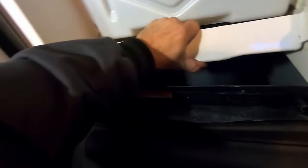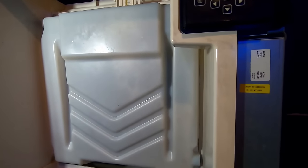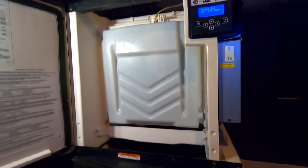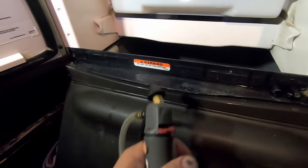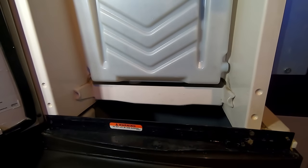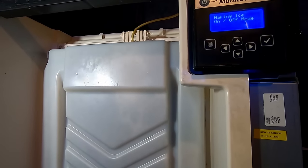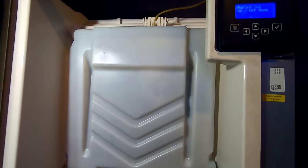Got that back into place — we'll start her over one more time. I've got the keypad on order, so we'll come back and run the cleaner through the actual machine — the disinfectant and sanitizing solution — when we return, since right now I can't get that button to work. The drain was plugged up, so I went ahead and hit it with my drain gun and blew it all out, then ran hot water through it — as the old plumbers say, hot water cleans out your pipes. That's as good as we can get for today. We're going to run one more batch of ice through here and see how long it takes to make. If you guys like the video and want to see more, hit that subscribe button — until next time.